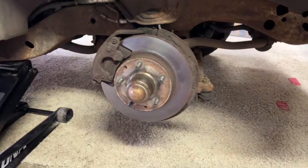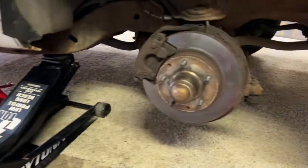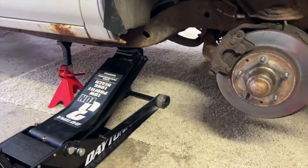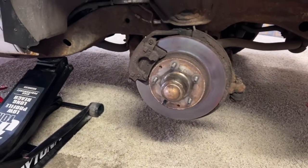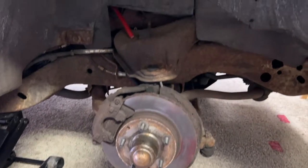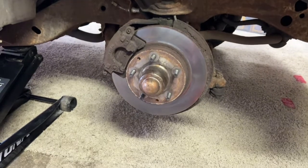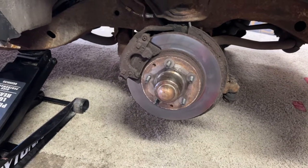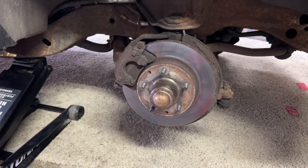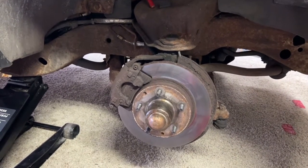Okay, so the first step, we're jacking it up. We're getting it on jack stands so it's safe. And I'm leaving the jack under here just as a safety precaution. And we pulled the wheel off. We don't have to explain how to do that. Just ignore that big 2-gauge power cable coming out of that. It's for another project. Now the next step is to start tearing this off so that we can gain access to the hub and then the shock and the spring behind there.